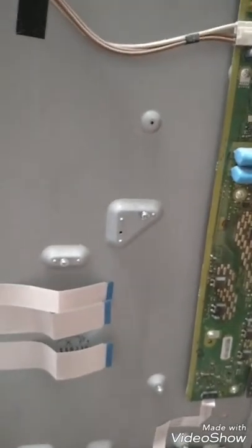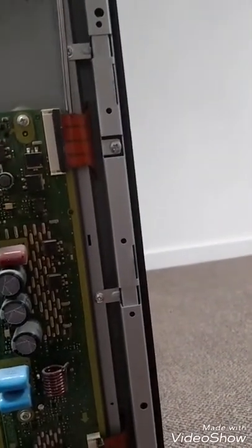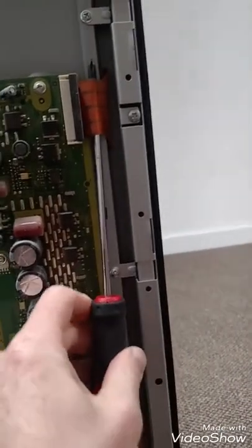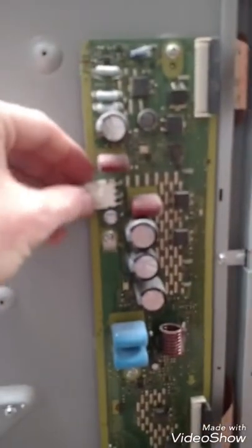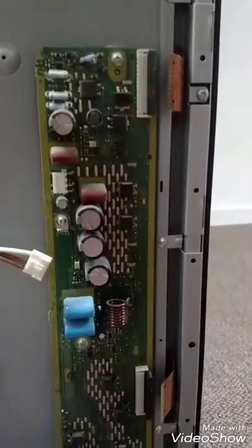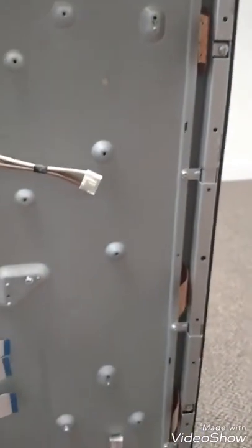With the main board off, you're going to take the SS board off. This is pretty straightforward — you just pull this piece down and shimmy that piece out. Undo these connectors and use a screwdriver to gently put it in there so it doesn't pull too hard. You don't want to rip it — if you rip it you're in trouble. Just give it a little shimmy and it will pop right out. Do the same with the next one — put a little pressure — and the bottom one as well. Up here push this button, pull it out, then undo the screws. Each one has an arrow indicating where a screw is. Take them all out except for the last one — unscrew it and make sure to hold your board so it doesn't drop and break. And there you go, that's how you get your SS board off.